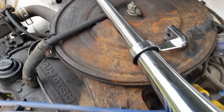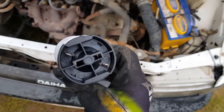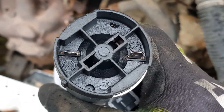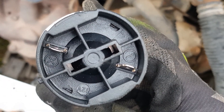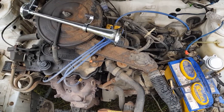Now this horn works by air blowing through it and the kit came with this little electric motor that blows air. There's a positive and negative symbol on there so that will help us wire it up correctly. If we wire it backwards it will suck — literally. And we'll be powering it using the stock horn leads. So let's begin our installation.